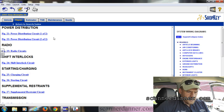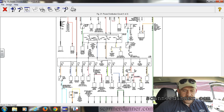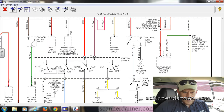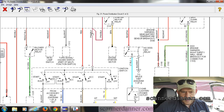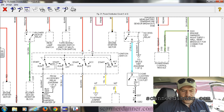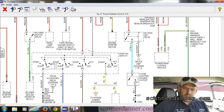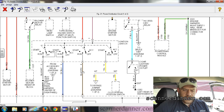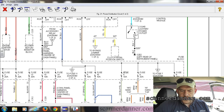After seeing this on the phone with him, I had him check some other things. Think about this: if this pink-black wire feeds the start circuit for our starter relay, it also feeds the run circuit. So maybe we have an issue with this pink-black wire. On the run circuit, there are some other fuses that get powered up by that. I was thinking we'll start at the ignition switch, but maybe I'll check those fuses first.